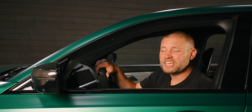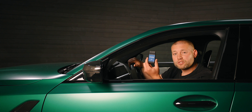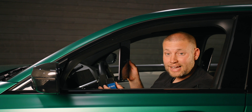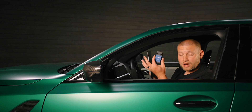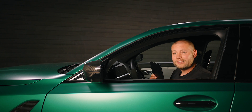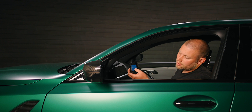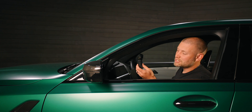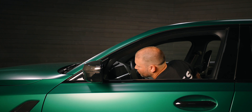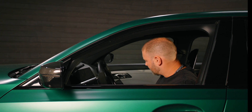That's what I'm going to show you how to code today. As far as time required, it's going to take you maybe five minutes or so, and you're going to need three things: we're going to be coding it with the Keys Wi-Fi E-Net adapter, which is the interface to connect the car to an Android tablet running Pro Tool. You'll need the tablet, the dongle, and the software license for Pro Tool — we have everything listed down in the description. On the back of the Keys Wi-Fi E-Net adapter it has both the network ID and the password, which is just 'Keys1234' with a capital K.